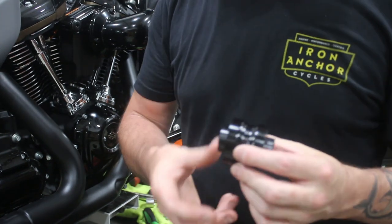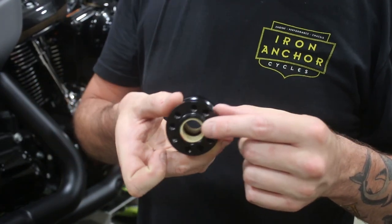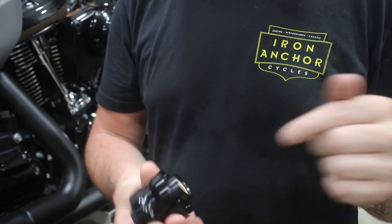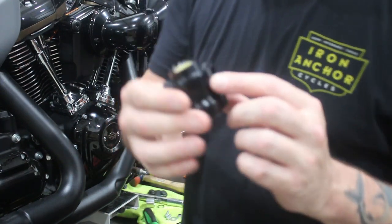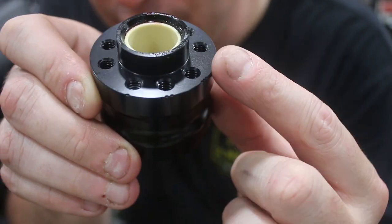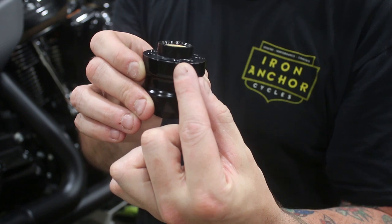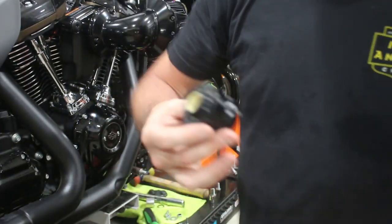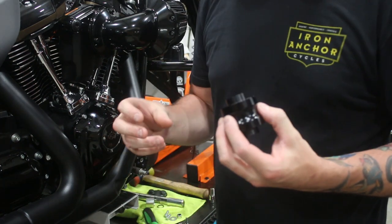Here's the hub for the Thrash and Supply brake arm. One side the arm goes on, the other side the clevis mount goes on, and we've got our plastic bushings pressed in here. These come in and out of the Harley brake arm really easy — just take a little socket, knock them out, and then you can just press them in, one on each side. Now one of the big benefits of this is that it's adjustable. There are little tick marks, and if you reference these, you'll basically be able to adjust to the center position or one click either way and set the clevis where you want it, which will adjust the height of the brake pedal. In our case, we want to put the brake pedal at a lower setting.